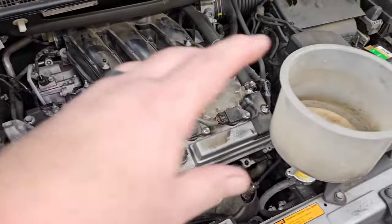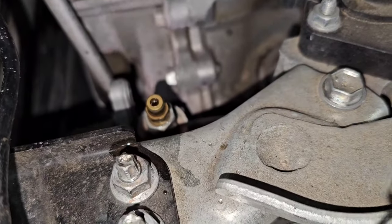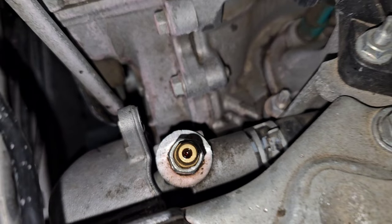I put a gallon of coolant in and then a gallon of water. This thing has a bleeder in the back — crack open the bleeder, wait until the coolant starts coming out, and it did. You can actually see it inside the tip of the bleeder. You don't have to go bananas tightening those things up — as soon as you get them tight, just go a little snug and stop. I've seen people over-tighten them and snap them off. Also, don't open those bleeders when the vehicle's running — when you open them while running, they suck in air because it's a suction side, not a pressure side, 99 times out of 100. So only open them when the engine is sitting still and not running.